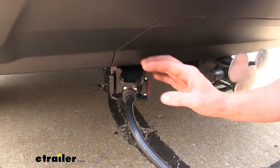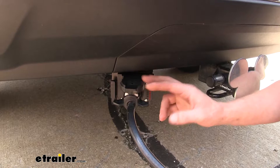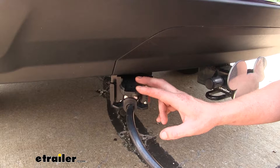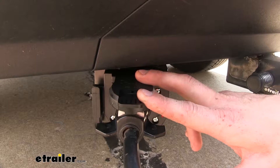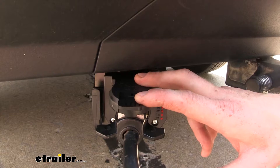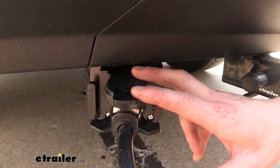Now if you intend on using a larger trailer that may have brakes or additional accessories such as a power jack, you may need some additional connections at your seven-way. There are breakout wires for those remaining connections that you can wire up as well. One of them will be for your brake signal, which is the output for a brake controller. It also has a charge line cable which is your 12-volt, so you can charge a battery on your trailer or operate a tongue jack. And lastly is your reverse light circuit, which you can tap into on the vehicle so those reverse lights will also illuminate on your trailer.